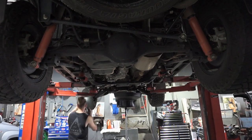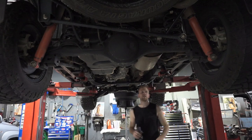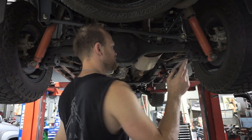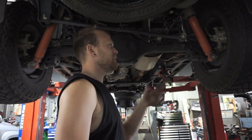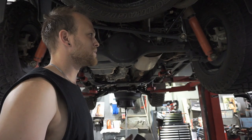So I've just got the front, do the same thing, just a quick check over for any punctures, checking for any adverse wear patterns. Looks all good. Now these front ones do tend to wear a little bit heavier on those outer edges from cornering. That's why about every 5-10,000 k's I do a rotate. The rear tyres flatten out because it's live axle on the rear and they're not turning. You can put the rear tyres on the front, that flattens out those old front tyres with that little bit of wear on the outer edges. Then you can keep doing that, and that's how you get the best life out of your tyres, from consistently rotating them and checking them as well, making sure the pressures are right and your wheel alignment's correct as well.